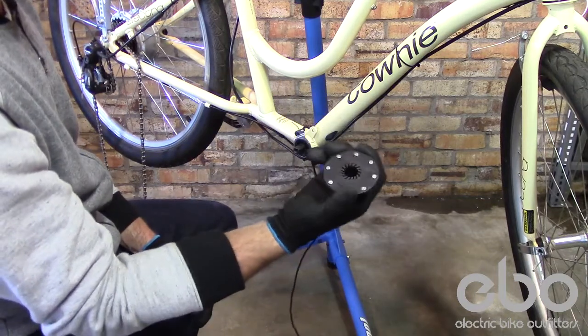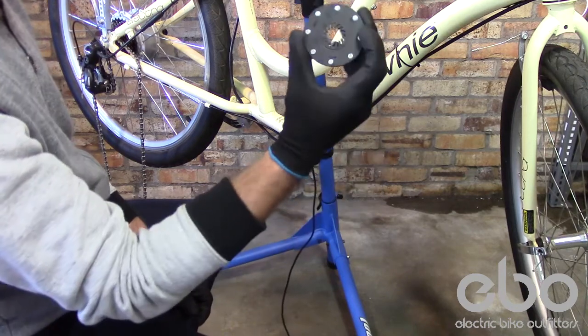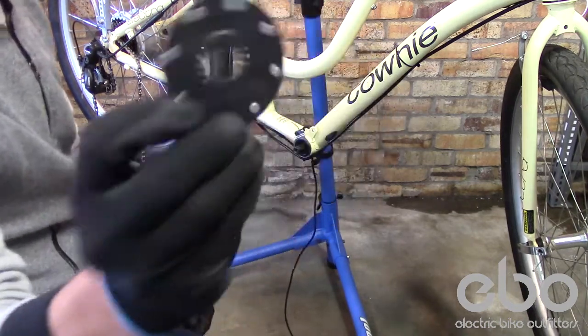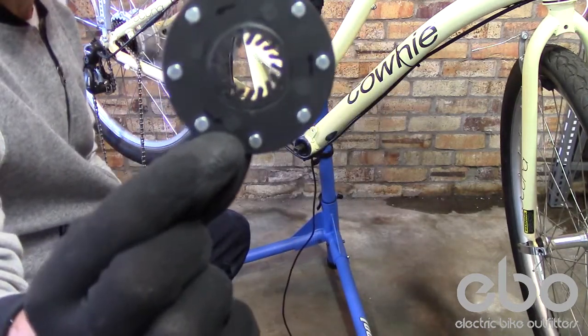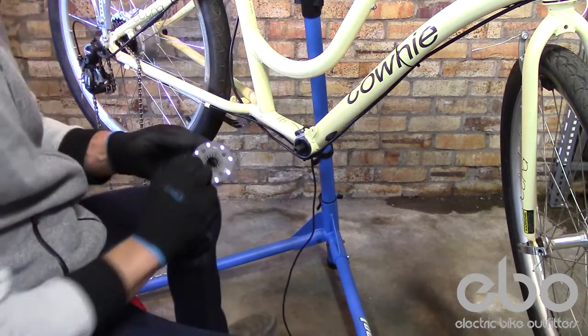Place your sensor on the drive side — you have magnets and arrows. Make sure the arrows are going in the right direction on the drive side. Then place the disc over the square taper.